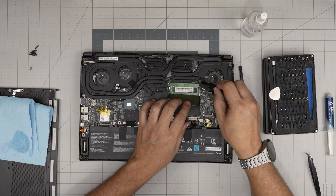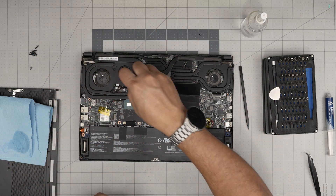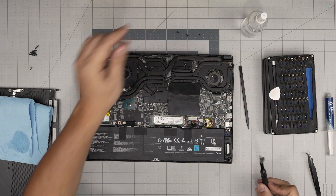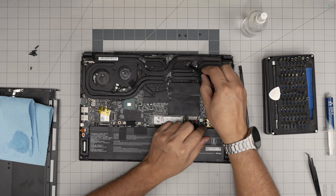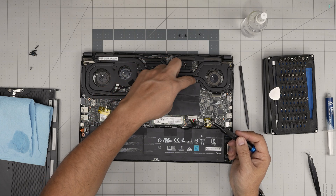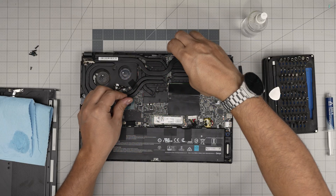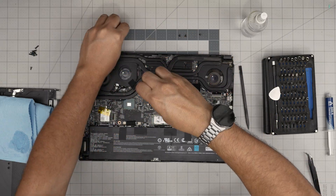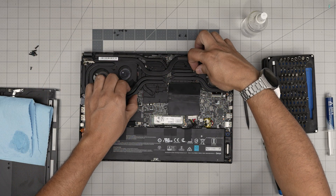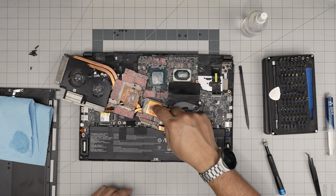We're going to remove one screw on the right fan and two screws on the left fan — one in between the fans and one in the corner. Then remove the heatsink screws: one here, one there, one in the middle. That's a total of five screws that touch the X-bracket on the heatsink. Once removed, grab the heatsink evenly and bring it up — and there we have the old dried-up thermal paste. It's kind of white but really dried out and discolored. There's nothing on the GPU section.